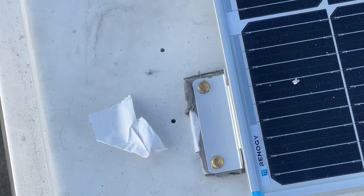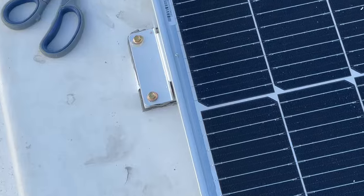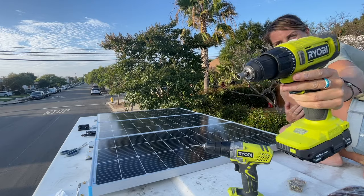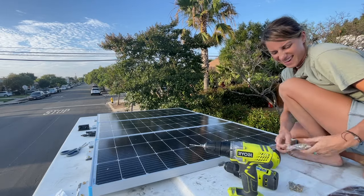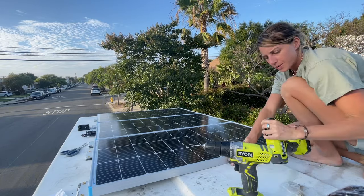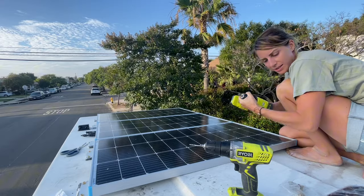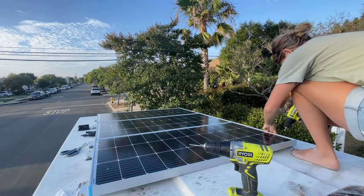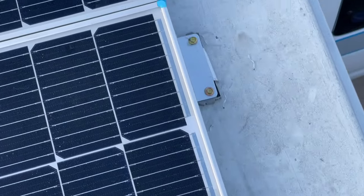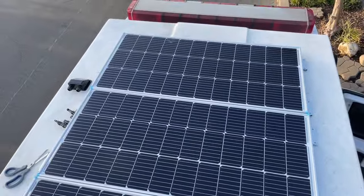We've changed the configuration so that the solar connectors will actually fit each other. If you have them too far apart, you're just going to need to get solar branch extensions — they're pretty cheap from Amazon in three, five, or ten feet. But so that we didn't have to do that, we just put ours right next to each other. This is the little solar cable housing that will take the cables down into the van. I've just secured the first two panels and I'm pre-drilling the holes. We're using a 5/16ths socket. First panel screwed in — two more to go.